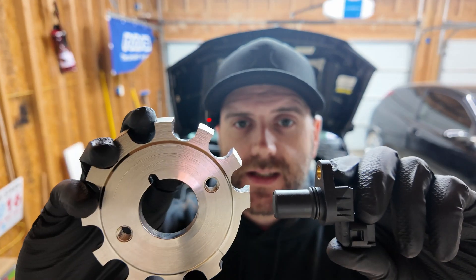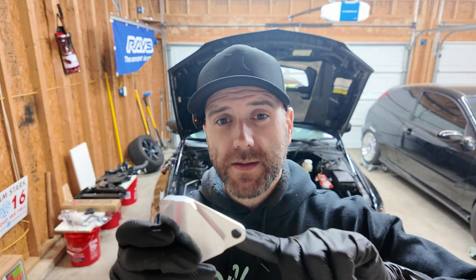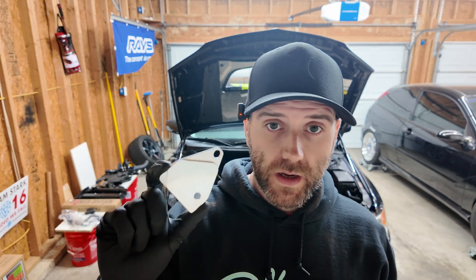This kit comes with a little adapter bracket that lets you move away from the factory crank position sensor to use the cam position sensor. Once this is in there, the distance it has to be from the wheel is a very specific range called an air gap — it needs to be between 25 and 35 thousandths of an inch. Kiggly Racing provides very thin washers in case you need to space it out. One of the bolts that holds this on is actually the bolt that used to hold on the balance shaft, so you do need a balance shaft delete to do this. That bolt also has oil behind it, so it's important to use some type of thread sealer on that specific bolt.